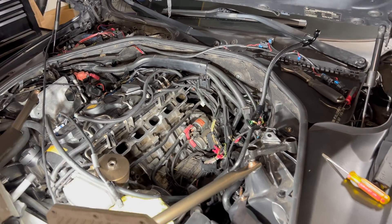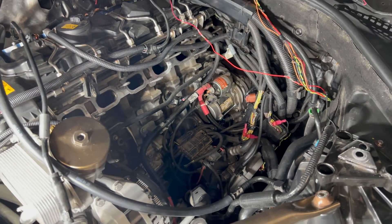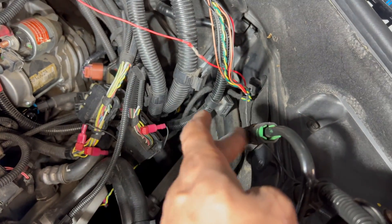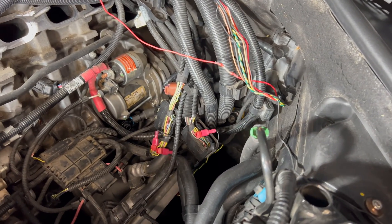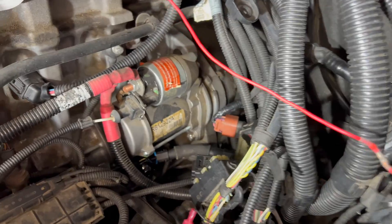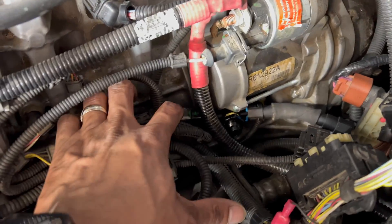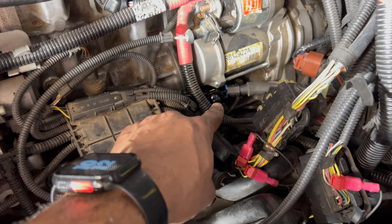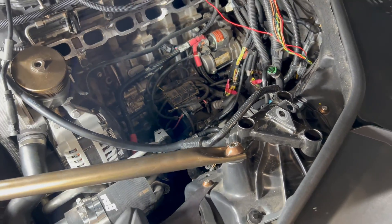Just a quick update — I ran into a little bit of a hiccup, mainly having to do with my fuel line. My T is now missing from here because I did not have enough fuel line — it wasn't long enough to make it from the intake manifold underneath over to this location. So what I did was just reverse my connection here. Basically the end that used to be connected here I just swapped around. So now I have my 6AN connection here that I can actually tap into for my fuel line and then run straight up. I'm going to go ahead and get this installed now.